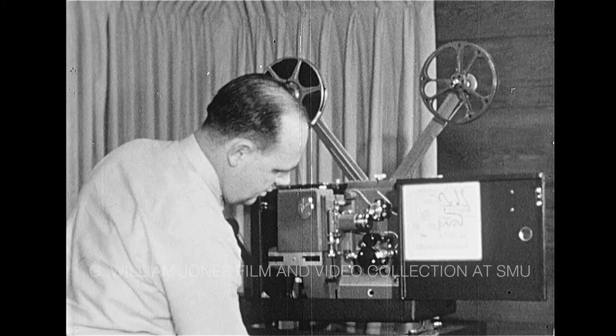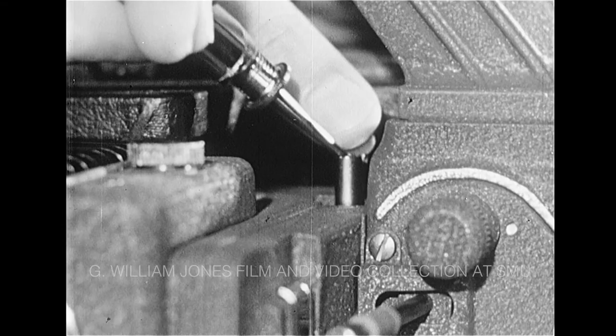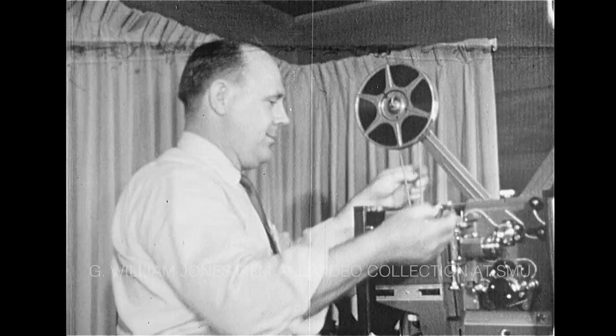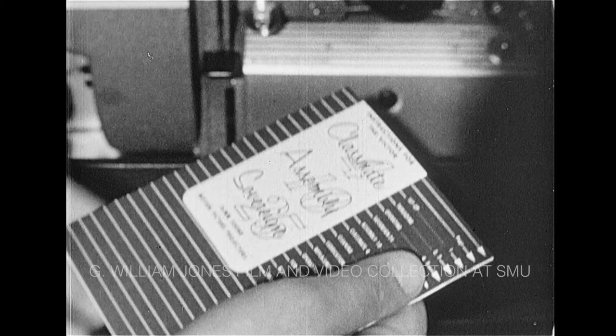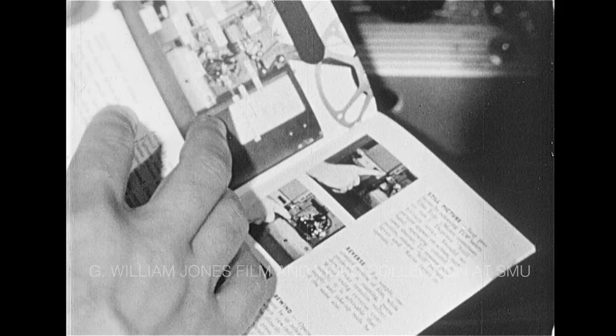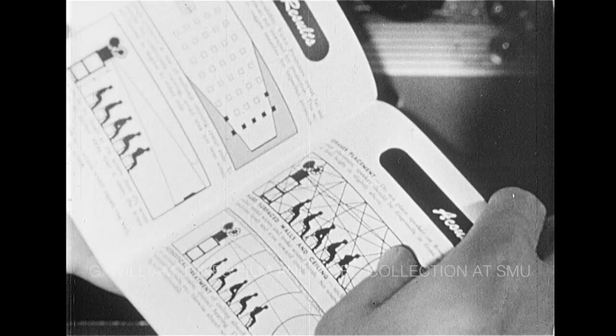After each 100 hours of use, fill the lubricating cup with the recommended oil. And that's it. Simple directions for replacing lamps, tubes, and fuses can be found in the Victor Operating Manual. Here, too, you will find some practical suggestions for improving your film showings.